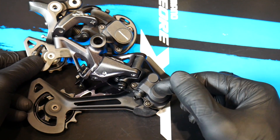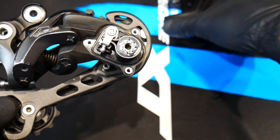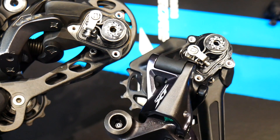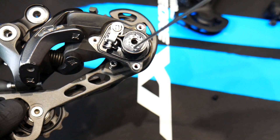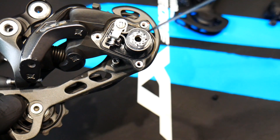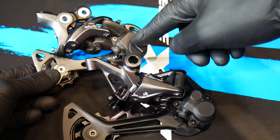Is there a difference in how the stabilizer or clutch works? Looking inside — here is the clutch on the M8000, and on the right side is the new M8100. As you can see, it's the exact same clutch. Honestly, I wouldn't change anything because it works well and is easy to maintain. After 3,000 kilometers in sometimes extreme conditions, there's no dirt inside. The clutch is also adjustable — that's where Shimano clutches shine, in my opinion.